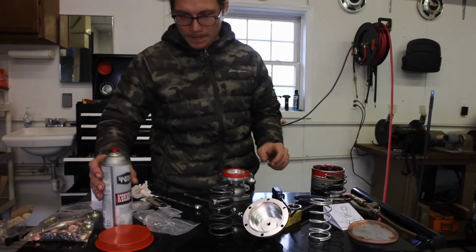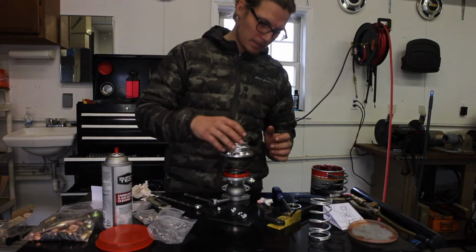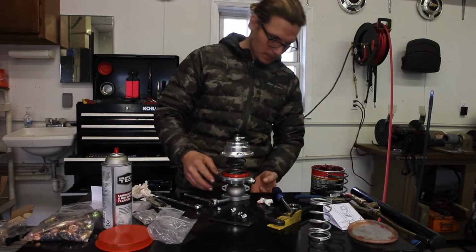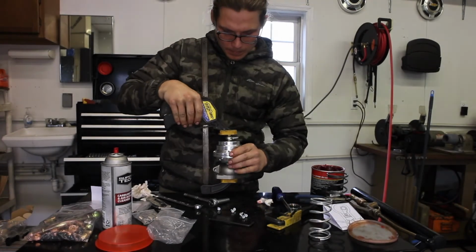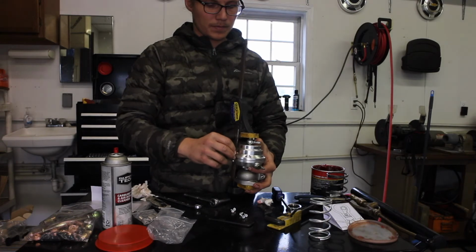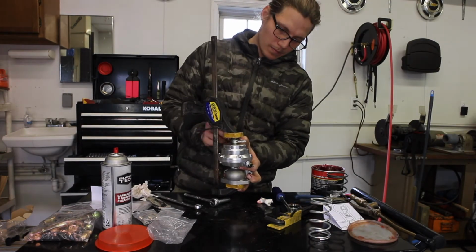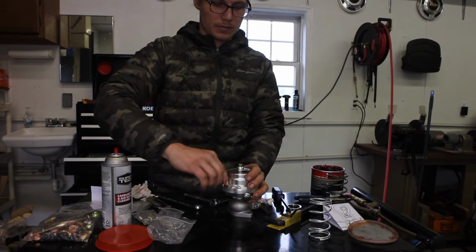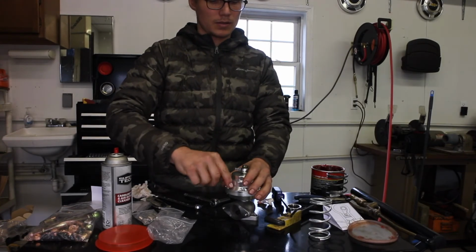That's tight. Alright, so we got this in without pinching the diaphragm. Diaphragm, that's the word I was looking for earlier. Let's see if it actually is a 10-pound spring, but it just had a leak, and we cleaned it up and we could figure out the leak. I hope that's the case. Otherwise, I have a 15-pound spring, and I'm going to have to swap them.